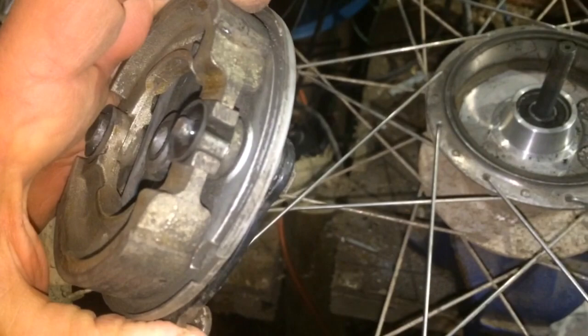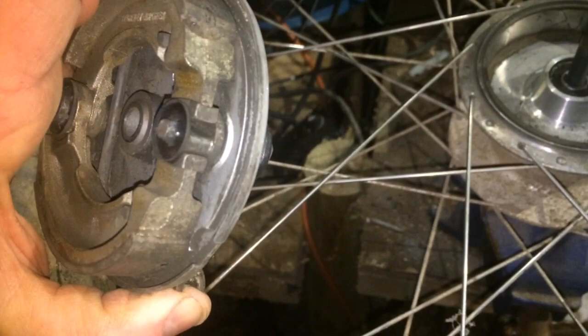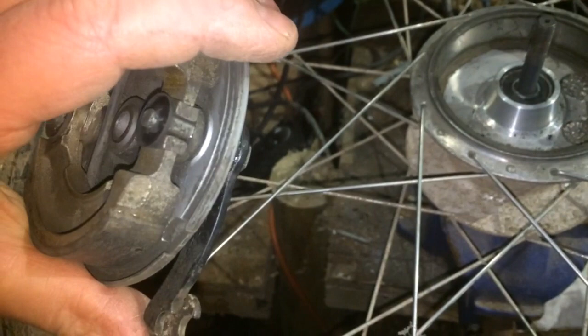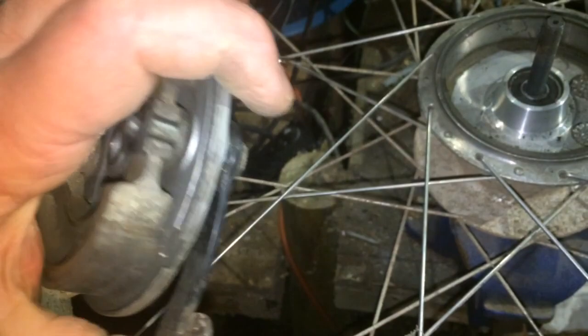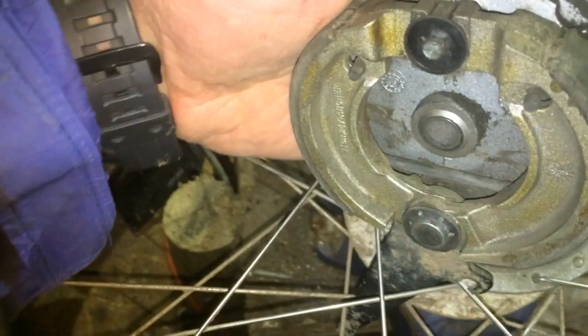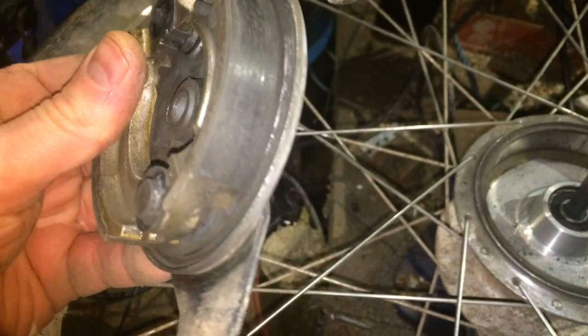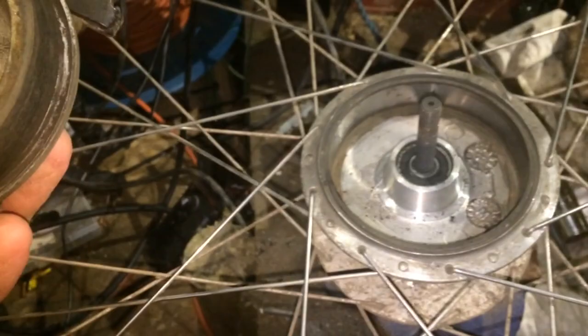So what I'm going to do — I'm going to get something thin like an old bicycle spoke or a cocktail stick, and I'm going to put a bit of grease right down in that gap. See the gap that opens up there. And also if you twist it the other way, which is the opposite way to how it would normally go, put some down the other side as well — some in that side, some in that side, work it down in. Be careful not to get any grease or oil or anything on the actual brake shoes or the inside of the braking surface.